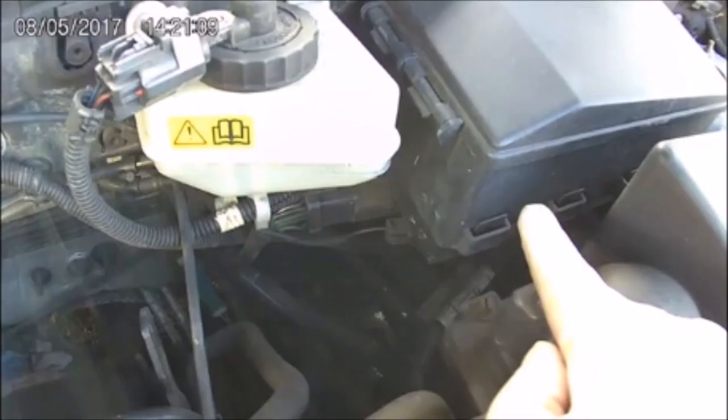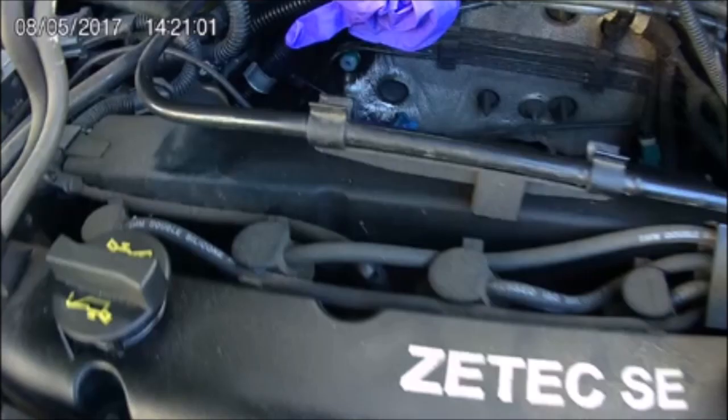Back on the engine side, put your 8mm bolt in. Then reconnect your top tube. Check your fluid level in the reservoir - make sure you've got plenty of fluid and be ready to add a bit more. Get a rag underneath the bottom. Put the top tube in.